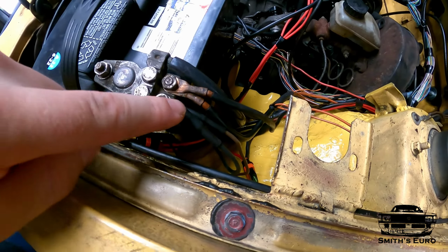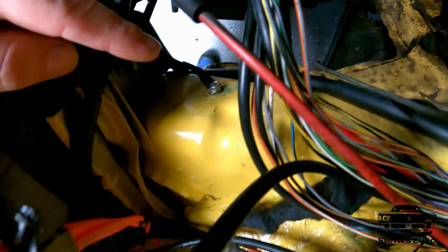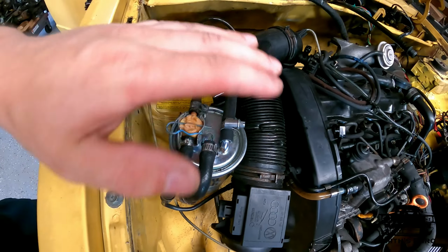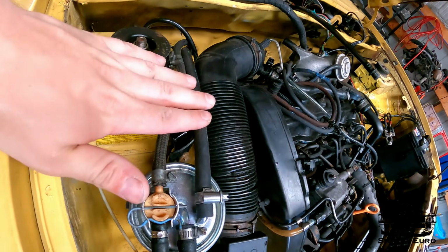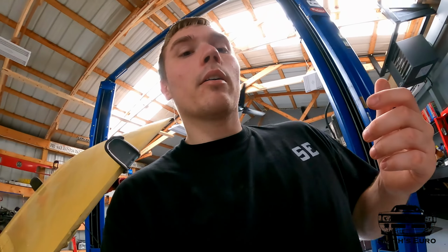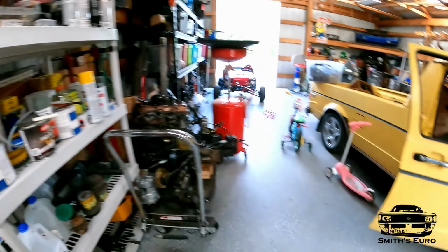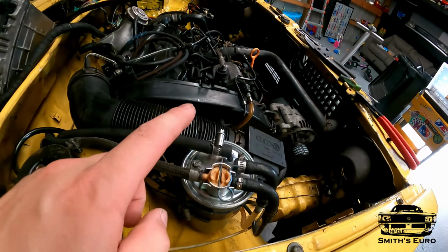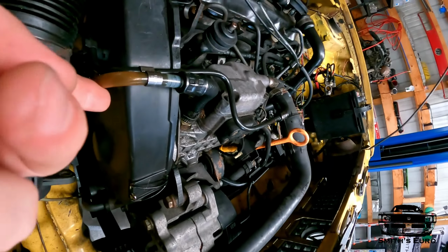I did add in a chassis ground that went from right here, goes down and around, just where the Mark One would go right here. I put the OEM rabbit hoses on, even though these technically aren't OEM, they've been replaced. And I use my vacuum bleeder that you can use for brakes. I put it right here on the return. You put it to air power and you just let it suck. It's pretty easy. You can see I have plenty of fuel in there.